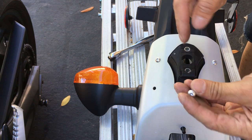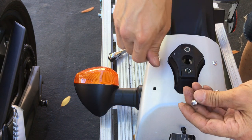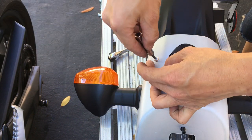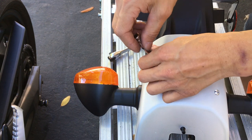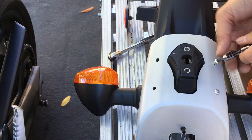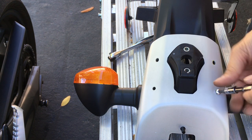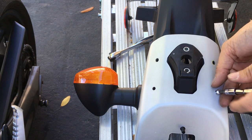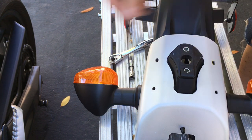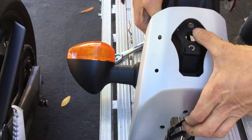This feels like aluminum — it's an aluminum button head Torx bolt. Very light, that's kind of cool. It's good to use a Torx head because aluminum is so soft. If you use an Allen-type head, if someone tightens it too much, they might strip it out.